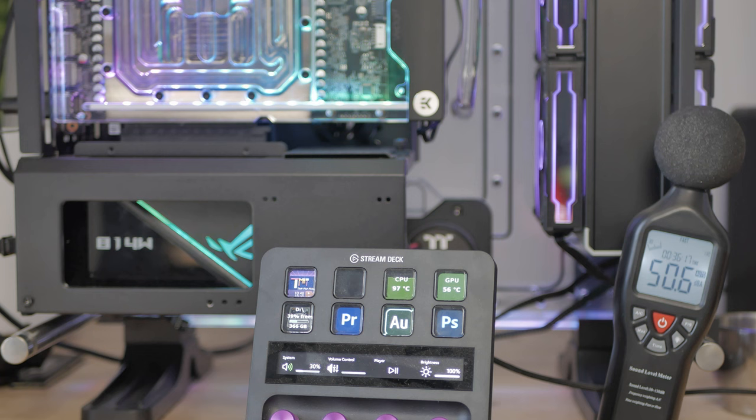In gaming, I average 600 watts on the power supply, and that is basically because the CPU is just not being utilized at all, and the GPU is firing on all cylinders, and again, stays at very, very reasonable, around 50 degrees. I'm super impressed. Having the push-pull configuration also blow some rather warm air through the components does reduce how much heat there is on the motherboard, which is always helpful even if it's not that much.